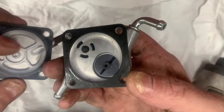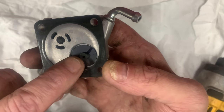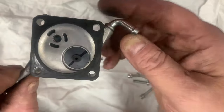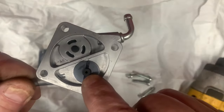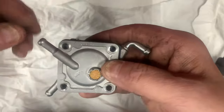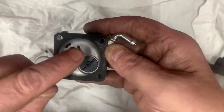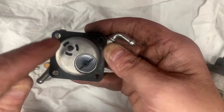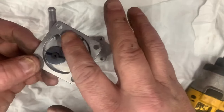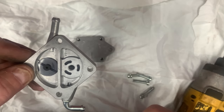Moving forward, we have the fuel chamber here that's going to have two check valves — one check valve is inverted and one check valve is in its normal position. If you flip this over, it's going to be just the exact opposite on the other side. Whenever the engine is running and pulsing, you've got your pulses acting on this diaphragm — it's pulling fuel up, fills this chamber up, then the fuel pushes down through this check valve and fills this chamber up, which pushes the fuel out to your carburetor.